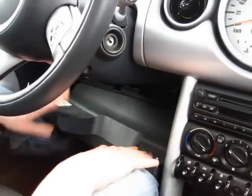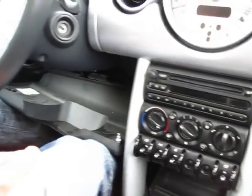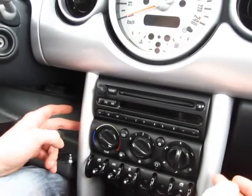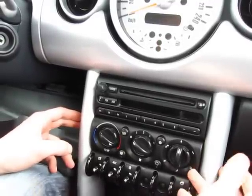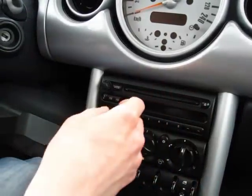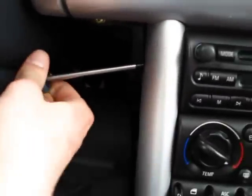You can just put it down and leave it like that. Now we're going to take our T30 or T35. There are two bolts on the side — they're different sizes, bigger on this side and smaller on the other. The owner already removed the cup holder, but on a stock Mini Cooper you'd have one here. Same procedure: remove those two bolts and you can remove the cup holder. So we're going to take our T30 or T35 Torx screwdriver and remove these two bolts on the side.